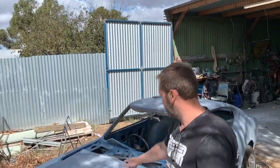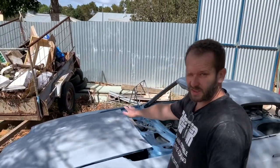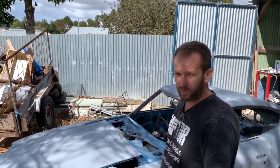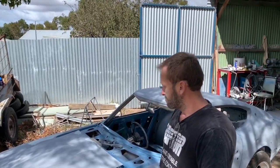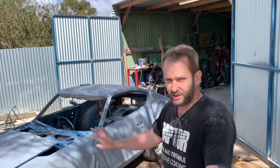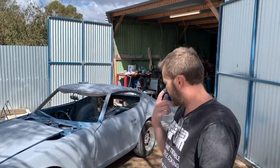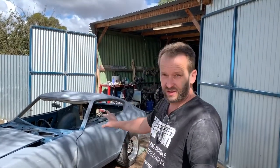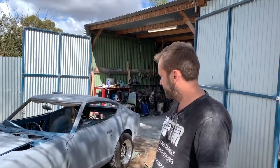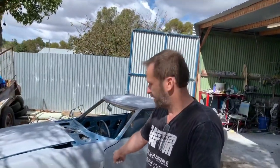So I'm going to have to redo a few things, like the bonnet. I thought it was dead straight because it had no filler in it when I took the paint off, but no, it wasn't. For the guards, I had to do a little bit of a flex to get the bolt holes to line up, which in turn made it flex a little bit in the panel and threw it off. So I've got a few wobbles down in the water panel down there.